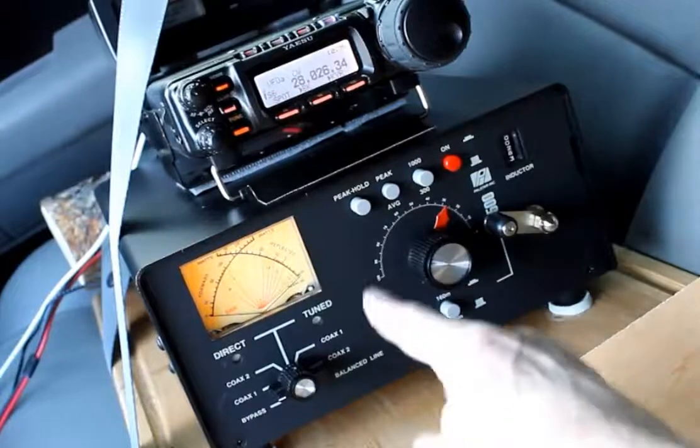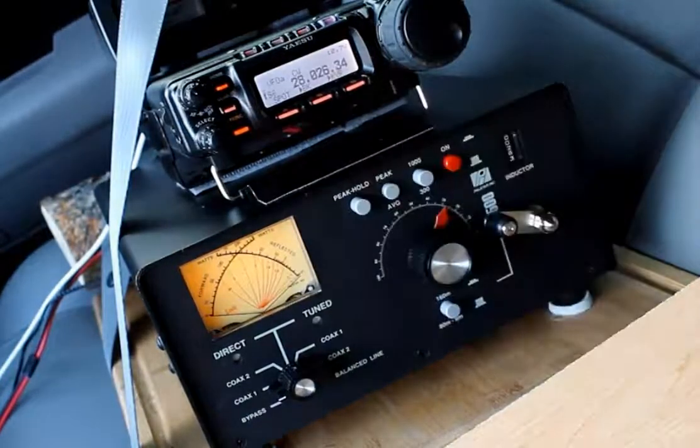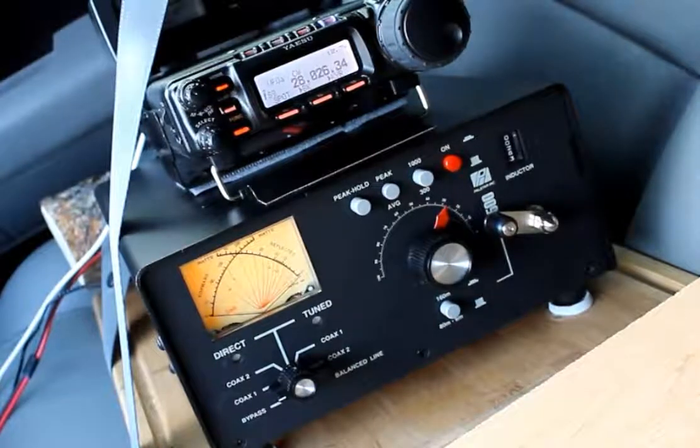So this thing isn't going to work when the vehicle is off. The radio, on the other hand, is connected to a deep cycle 35 amp marine battery to keep it independent of the vehicle ignition system — also because I discovered that a cigarette lighter adapter is not adequate to handle the current that this transmitter draws. It gets so hot it can burn you.